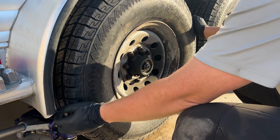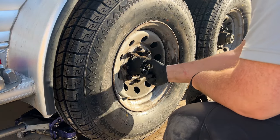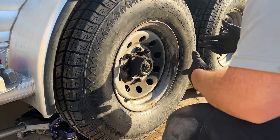Sometimes there's just a hair of play. Maybe you can hear that little thump thump and you don't really want that. You just want to hand tighten it and shake it, make sure that there's no play. And that's what's going to give you a longer bearing life.